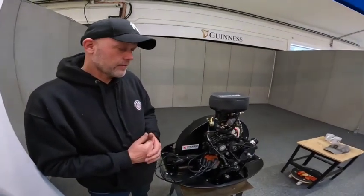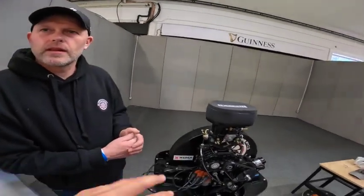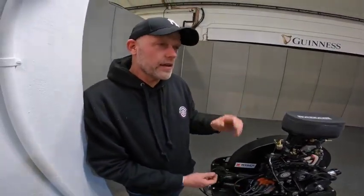With the right tuning you can easily get in excess of 130 to 140 bhp. What's the cost of the kit? The sleeper kit is £1,680 all in — that includes VAT. We don't charge VAT for customers outside the UK, though there may be import taxes. So at about 1.20 to the pound, you're looking at around $1,900 US — turnkey. That's everything: open your engine compartment, take everything off, and put this on your 1600 to 1776.